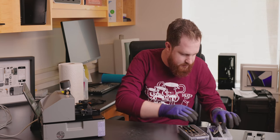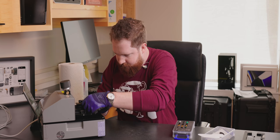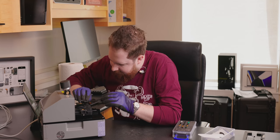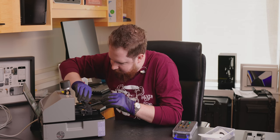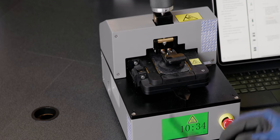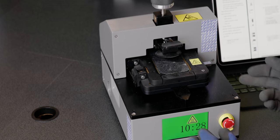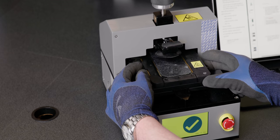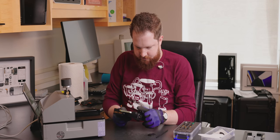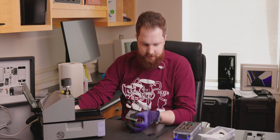Here's what they need to give you — another tool — because you can't trust the weight of a little suction cup alone. We flip the handle to release the suction cup, lift up, push the release knob, pull the phone out — that is pretty toasty — and then pull the phone out of the pocket. We grab the display by the top, and everything shuts off on this very annoying machine.